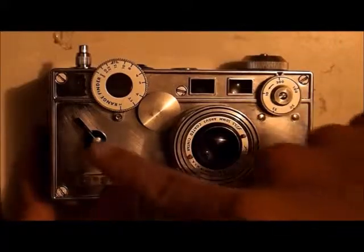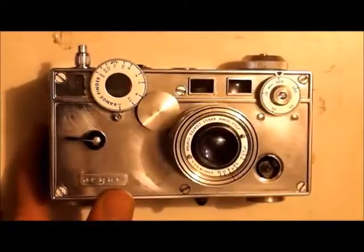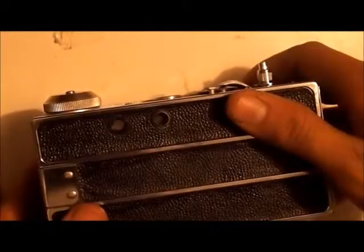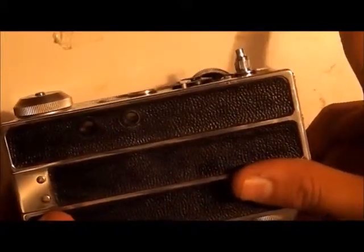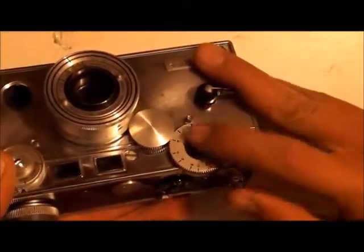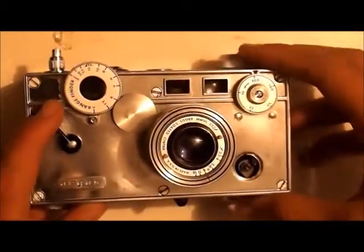Once you've selected your shutter option, here is the shutter cocking lever. You're going to depress this, and you'll see that it'll go down in a lock position — you'll hear a click. Then turn the camera over, and looking through the left window this time, compose your image, see what you want to get, and then depress the shutter, and you take your image. When taking an image, you want to ensure that your finger isn't in the way. A lot of people have the problem that whenever they're taking an image, their middle finger or ring finger will be in the way, and you don't want that to happen because you're going to have the shutter open a little longer than you want to. So on to the next part, and that is loading in the film.